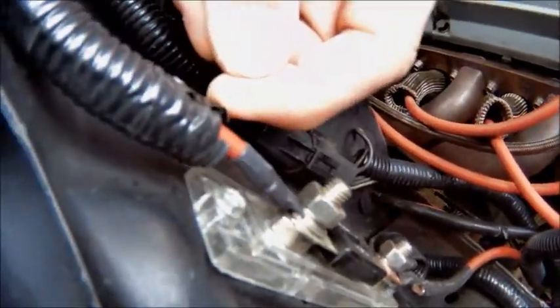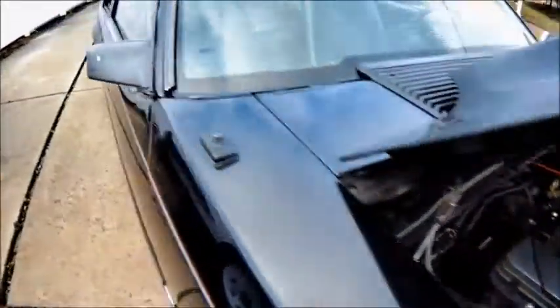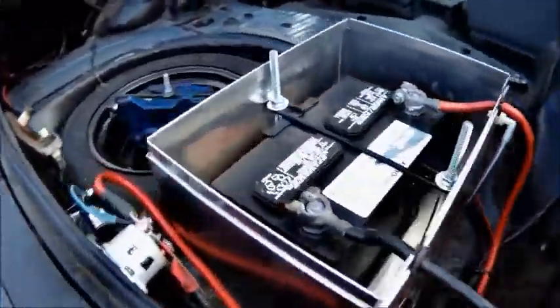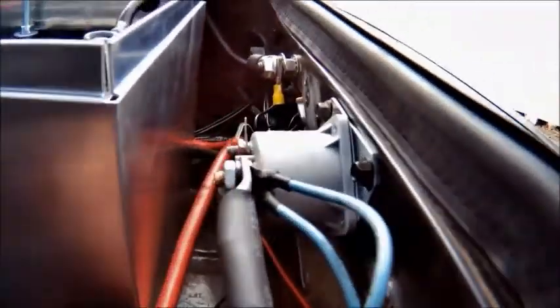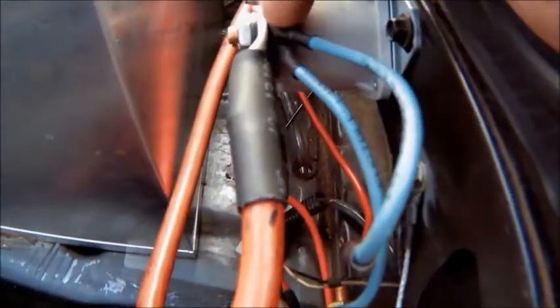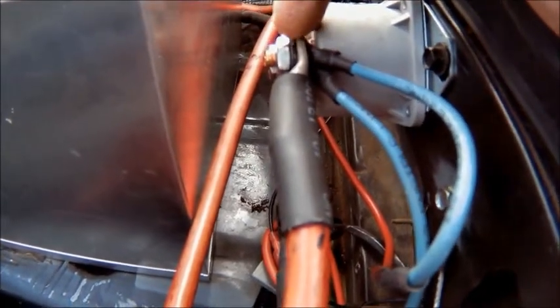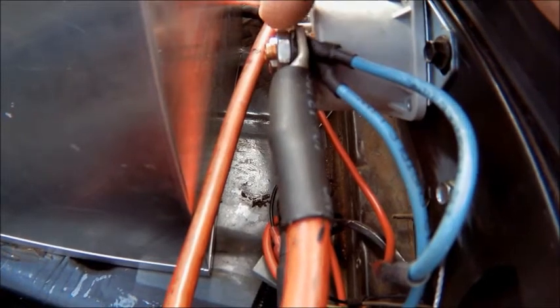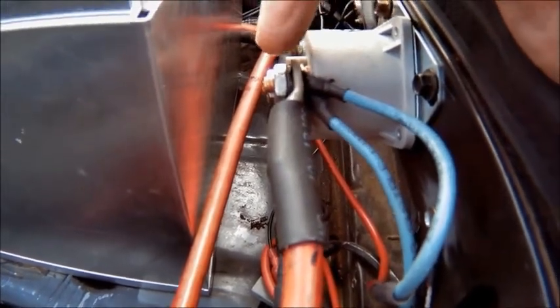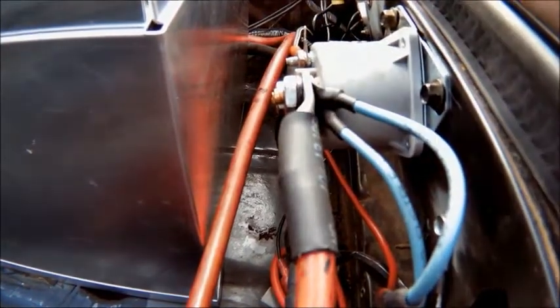So following this charge wire, we're going to go to the back of the car and see how that connects. That wire is run all the way to the back of the car, and where it connects is right here — I have it connecting to a fusible link. This is another secondary safeguard. This runs to the positive side of the starter solenoid where your positive battery cable goes on, and this sends juice from the front of the car — the alternator — back here to the battery. And that's what keeps the battery charged. So that's the charging side of the circuit.